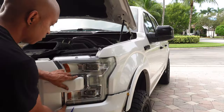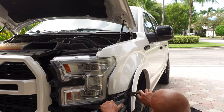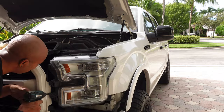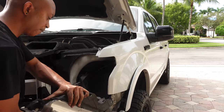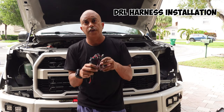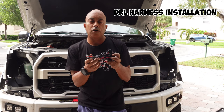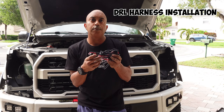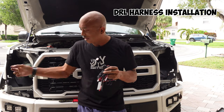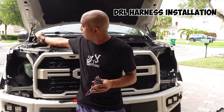After you take out one light, go ahead and take out the other light as well. The reason I do this is because I'm going to be running the harness for my daytime running lights — I want to run the wires first and have them already in place when I put the lights in. The process for removing the other light is the same: remove the fender cover by taking out the bolts and clips, take out the bottom trim piece, loosen the bolts for the lights, take the lights out, and disconnect the harness. Now let's talk about wiring up the harness for your daytime running lights. You're going to get a set of wires in your package from Alpharex.